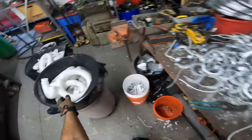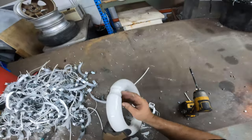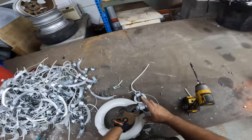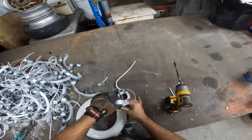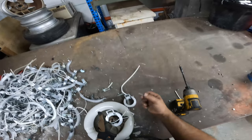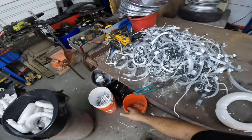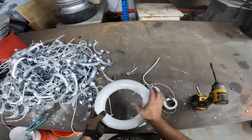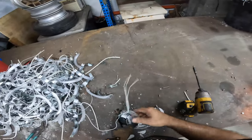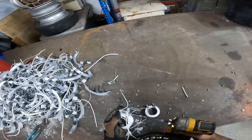Now, when this is on the light, let me show you. It has the wires underneath like this, and these things, which are like overlapped, you know, it's like a little rubber thing overlapping. And if you're taking this apart and you wind up bending it this way or that way, that wire starts wedging and putting weird pressure on this, and then you can't get that bolt out. So it's something I learned, not to disturb them, and if they do turn, try to put them back in their position before trying to pull out that bolt right there. Now, as you can see, that's still on there. And we just hold pressure on it, hit it with the gun.